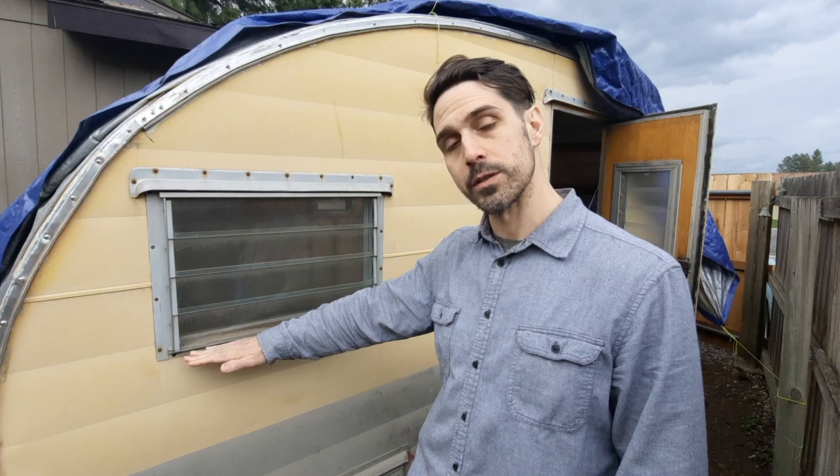First things first when installing a service window: consider accessibility for the customer. Overall height — I don't like my window really high up where you're looking down at the customer. I want to be as close to eye level as possible. That's sometimes hard when you're in a trailer already lifted up. One thing that's nice about these older travel trailers is they do sit a little lower — that's a benefit versus an old box truck, which sits up much higher. So this is a good starting point; the level here is nice.